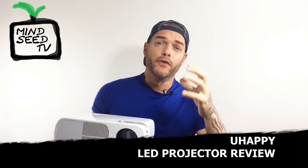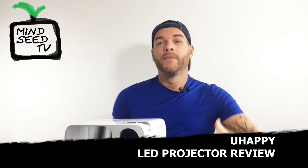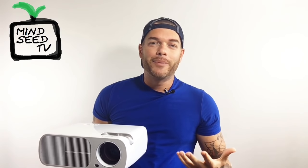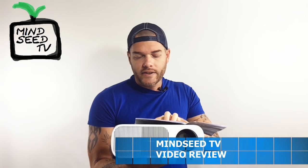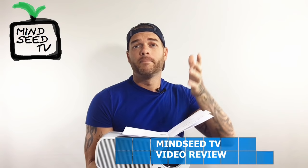The one thing I will note about projectors like this: make sure you have a lot of room in your setup. If you're planning to use this in a bedroom or living room and don't have a lot of space, you're not going to be able to get a 120-inch screen. The closer the projector, the smaller the screen — you need to be very far away to make it extra large. In this review I was only able to get about 70 inches in my bedroom. According to the diagram in the user manual, to get 128 inches you need to be 4.2 meters away from the screen.